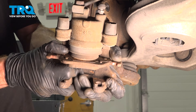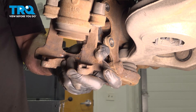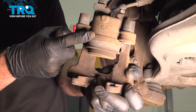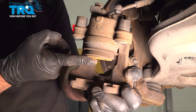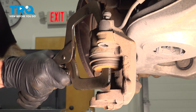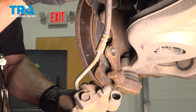Now we can remove the inboard pad — it has a couple of clips that go up into the caliper piston. Give the pads a quick inspection to see how they've been wearing. While we have this in hand, pay attention to the piston and the boot around it. If you see any fluid coming out of this area, the seal internally on the caliper is damaged and you'd want to replace the caliper. This one looks fine. We'll push back the caliper piston using a caliper piston compression tool, then set the caliper aside so it puts no pressure on your flex hose.